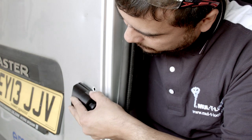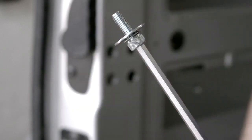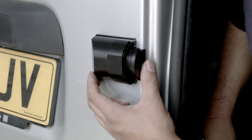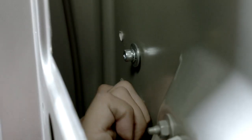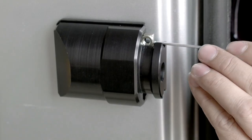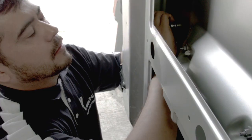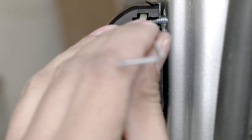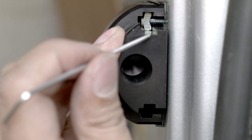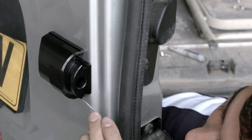Holding the lock and gasket in position, we can now insert a socket head bolt, serrated washer and a large flat washer through the door skin into one of the fixed hole positions, but we will not tighten it at this point. Once done, repeat the process for the other fixed hole position. Taking the weld nut, insert it into one of the slots in the orientation shown. Then insert a socket head bolt, serrated washer and large flat washer through the door skin while sliding the weld nut along the slot until it locates with the bolt. Again, we will not tighten it at this stage. We will now repeat the process for the other slot.